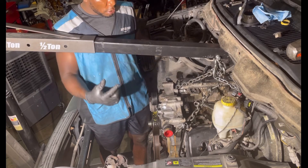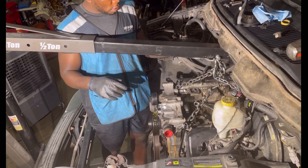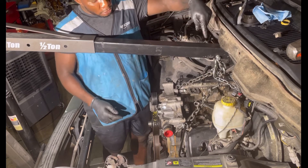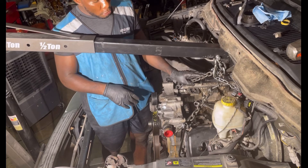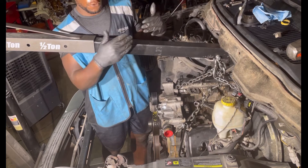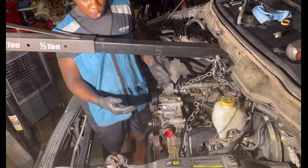It's what you'd call chaser bolts — chaser threads. When you put them through, it threads into the transmission. You put one in, then I was able to push it up from one side, came back and lined it up, went back and put the other one in, then came back and put the two top bolts. So there's a total of four bolts holding it right now. After doing that, I tightened all four bell housing bolts, then came here to install the side engine mount.